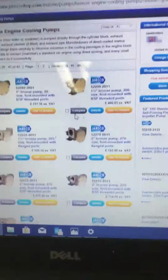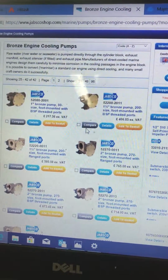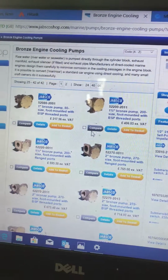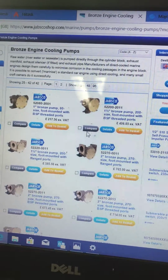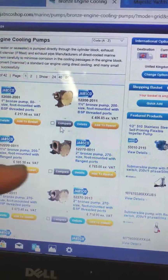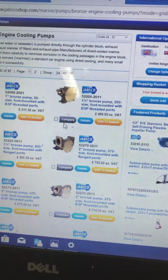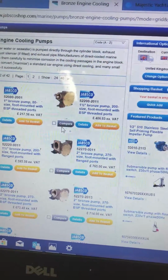So I'm going to go ahead and pick that and get that going. I have already made it more convenient. I've run your engine. I put the check valve in the bottom. I put it in horizontal, and we're adding a valve to the top and a quick disconnect for your hose. So it'll be very easy to prime, should you have to prime it. But if we go to one of these pumps, every time you hit the key, you're going to have water. You have to change your impeller every couple of years, but in that period of time, every time you hit the key, you're going to have water.